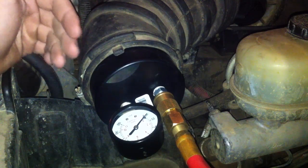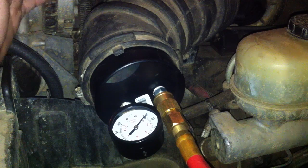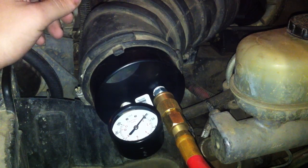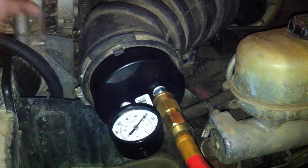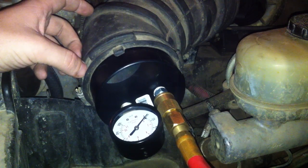Don't go crazy with the pressure, and don't stand in front of this thing when you've got it pressurized — I've had them pop off on me. It's kind of cool though when you turn it off: listen to your turbo whistle because you don't have the motor loud and drowning it out. This is going off to one of the members on FTE since I've already got one. Any questions, feel free to let me know.